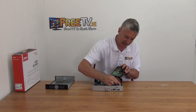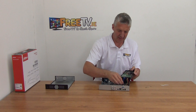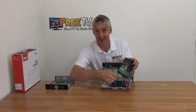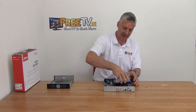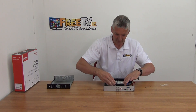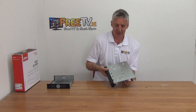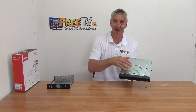I'll push this through here and then push it in here. Note that there's a little plastic clip on this one and a little metal clip on this one — you squeeze those when releasing the SATA drive or trying to replace it for whatever reason. I'm going to slide this down now and line it up with the four holes. If I turn the unit over, we can see the four screws sticking straight through, and I just slide it down so when it slots into position in the base, it locks in and holds it securely.